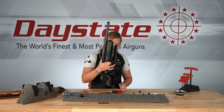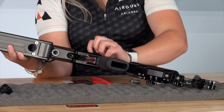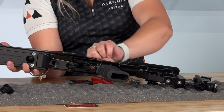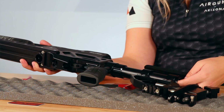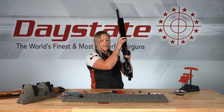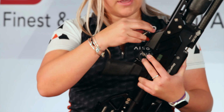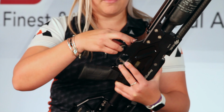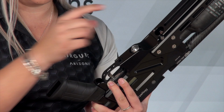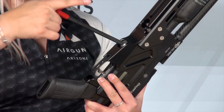Remember to take the dust cap off because that will be impossible to take off. And so on this side, you can just pull the battery wire out and it's really easily accessible. Next up, I'm going to use this plastic washer that comes with the little battery wire just to put on in the end here. It just helps to improve the contact surface between the screw and the chassis, because the chassis is metal and the screw is metal. It just helps to pull it a little bit tighter there. So I just put it in there and tighten that back up again, like that.